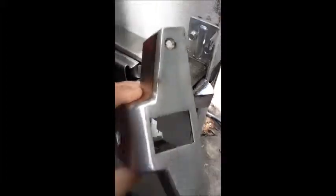Hi. Typically, the cover, if this is catching on the latch, it's something you would just fix on location. If you see, the cover attaches here, the same place on the bottom, and these two flanges. Now, these flanges, they can get bent for any number of reasons. If this is even bent slightly from the position of the one on the bottom, you would find that the cover doesn't sit properly, and it could catch.